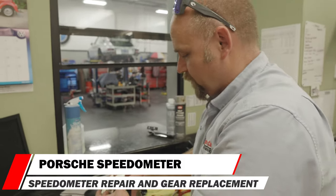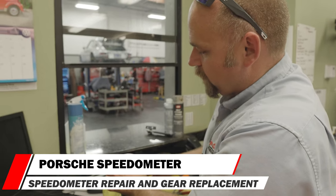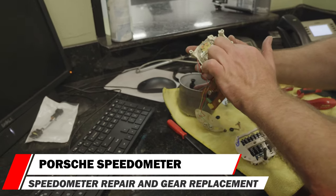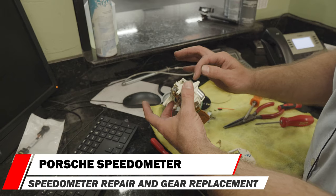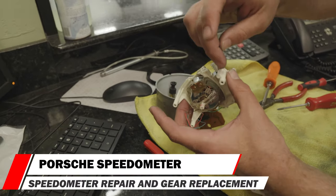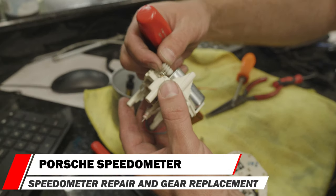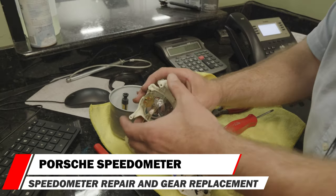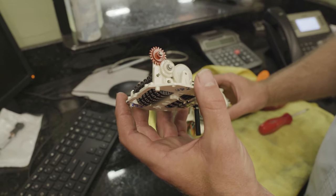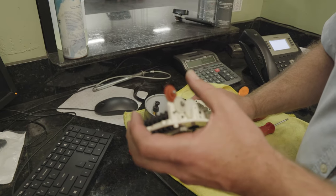The odometer didn't work on this car. We've got the lower motor carrier — I'm going to call this the motor carrier. It houses two motors: one motor for the odometer and one motor for the speedometer. The other screw right here has the plastic base broken out, that's why our threads are exposed. You can see how the motor rocks back and forth because the screw is loose. So is that enough to not contact the gear? The gear actually was not a problem because that red-orange gear there usually comes out broken. Somebody didn't put the e-clip back on.